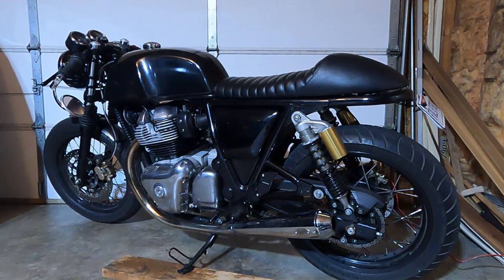If you ever tried to run up to 100, 90 to 100 starts to struggle. With the 17-tooth sprocket, it's like that's not there. Over 100, it seemed like maybe it was struggling, but I didn't keep going. I don't know what the top end is on this. I don't want to keep doing 0 to 60s and top end all the time, you know what I mean? It's not broken in yet, right? But we'll see. I'll try and get film of a 0 to 60 with the 17-tooth sprocket and the Revelry Racing Map.